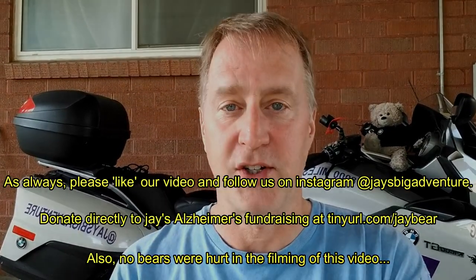We finally got the bike back together - sorry the battery died during that process, but it was just a matter of putting the body panels back on. Watch the disassembly video if you need help with what goes where. Got the bodywork all back on, radiator on, oil cooler cleaned. Today I went out for a pretty good ride - temperatures hit 98 degrees on the way home on the interstate. Normally the bike runs a couple bars above the midline in that heat, which is why I got concerned. Today I had no trouble and could run the bike as hard as I wanted. The radiator cleaning made a huge difference - good news, because that curved BMW radiator would not be cheap. Next project: taking the bike to the dark side. Stay tuned.